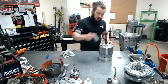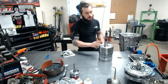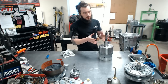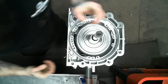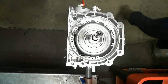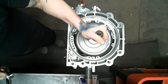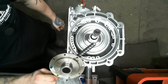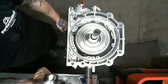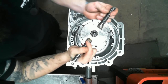So we'll take our whole assembly, we'll leave our ring sizer on for a couple more minutes, as it does take time for them to size up and everything. So give them 10 minutes or so. Take our assembly, place it in, and sometimes I've gotten cocky and was able to do it with my hands. To make it easier on myself, I have a junk converter tool rebar thing that we've made, and we shake it in. It's just a little bit easier.